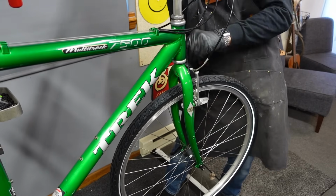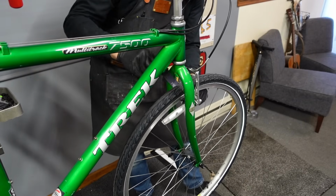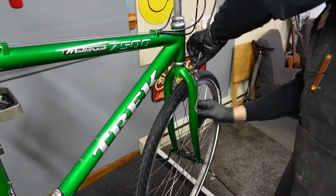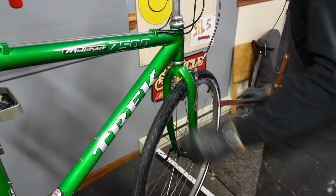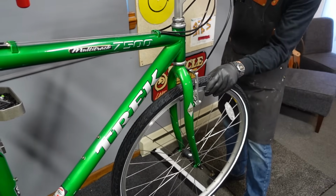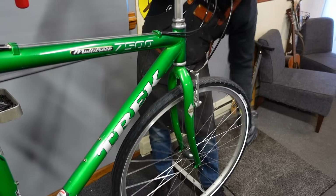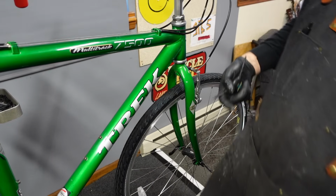And I'm kind of roughing up the pads here too. And if this doesn't work, then we'll toe the brake pads, which I just don't like toeing brake pads. It ruins the really good feel, and these brakes feel so good. It's also just a trade-off. Let's see what happens. I'm gonna just kind of lightly, and they seem to still want to howl. Okay, let's toe them. It's gonna be hard to show.